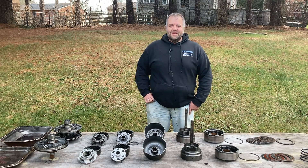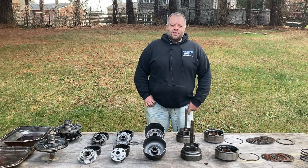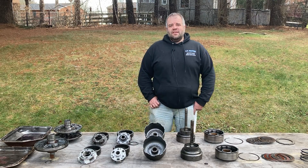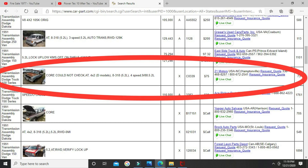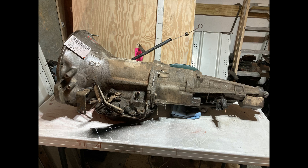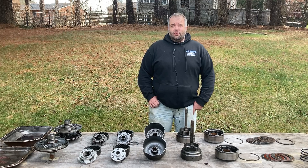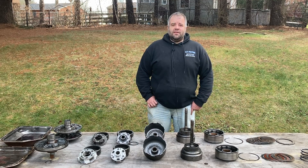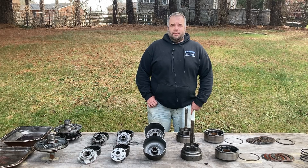Happy New Year's Eve. We got our 904 torn down — you guys saw everything that came out of it, all the pieces, including that broken pressure plate for the high gear drum. I tore down an A500 core that we scored from a local junkyard for $75, because I knew it would have that pressure plate and the deep pan I wanted to run. It also has some other things that might make for a nice upgrade, and you can buy an old junk core like that for cheaper than you can get the parts.